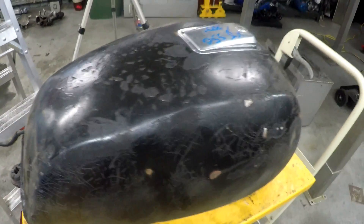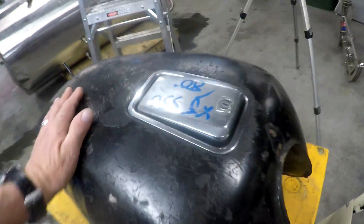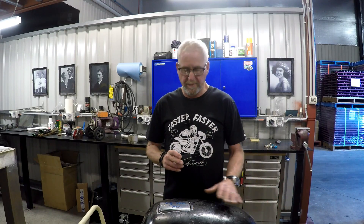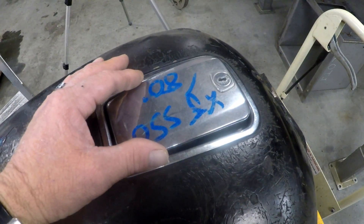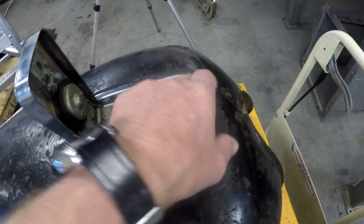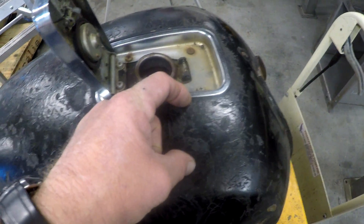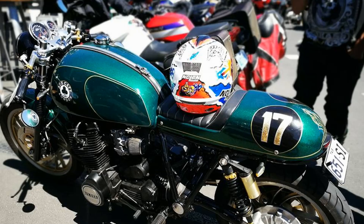This is the tank. It's as rough as guts. It's got a couple of really nice big indentations in it on the corners. The paintwork is an absolute shocker. My plan is to coat it with a chemical stripper and get all the paint off it right back to bare metal. I want to continue the theme I've got on basket case already — the fuel filler flap on the other tank is removed by three Phillips head screws. I cut that out, another panel was welded in, and then a piece of two-inch exhaust tube was welded into the tank to receive the Monza-style fuel cap.